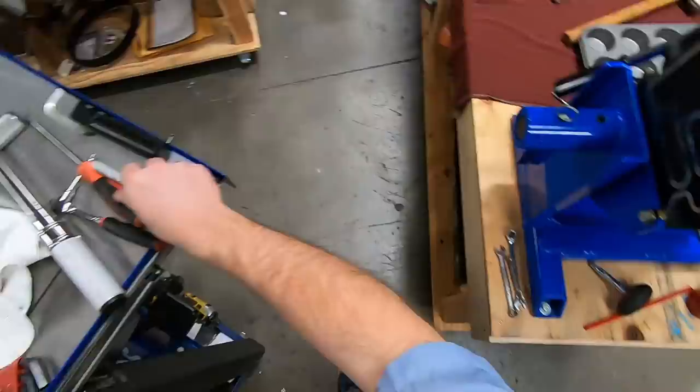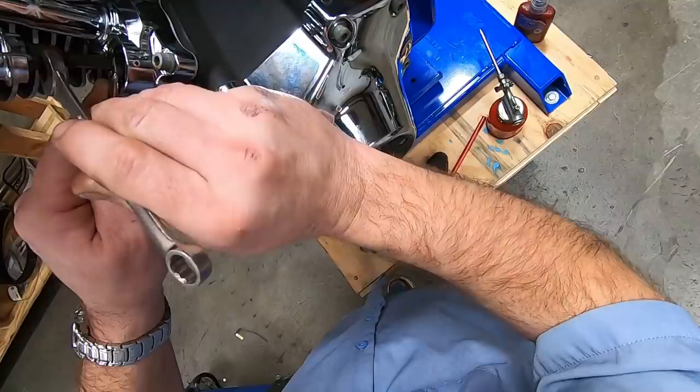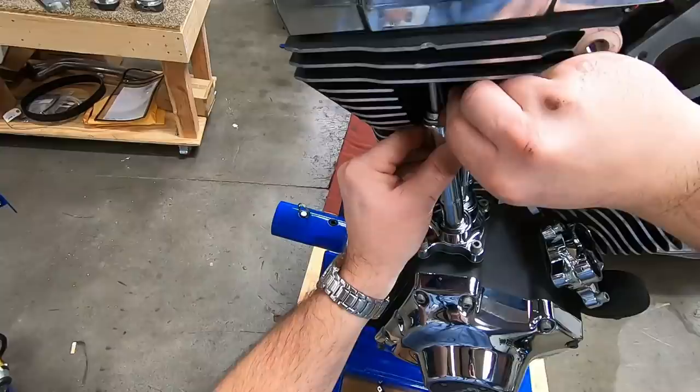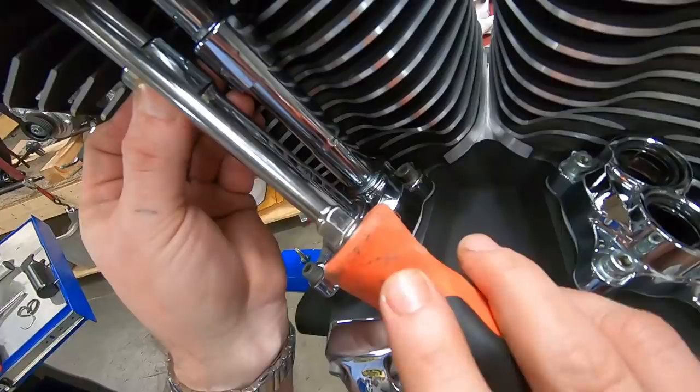Quarter inch wrench. Do not turn the quarter inch. Hold it firmly where it is, and let's do our turns. All right, we've waited until we can spin the push rod. We're good to go. Let's pop that down there. Make sure the O-ring's in place. Bring this up. Grab our screwdriver. Slide that in there easy, and it will snap right into the O-ring.